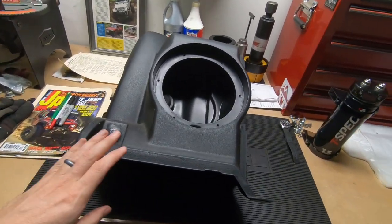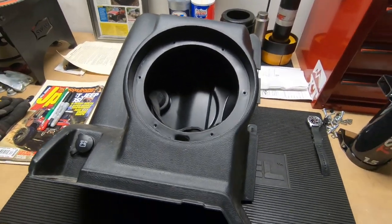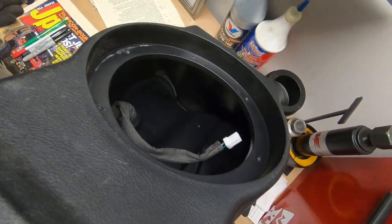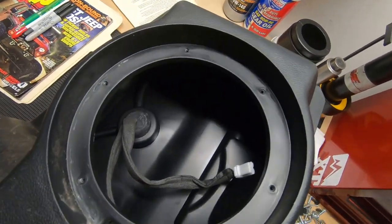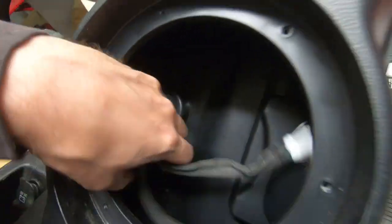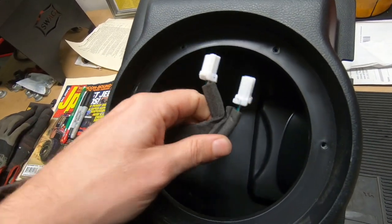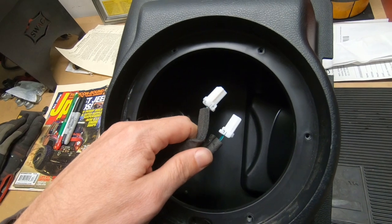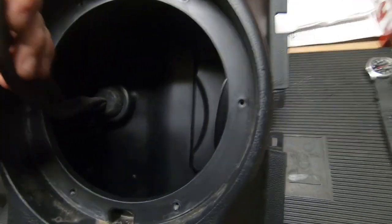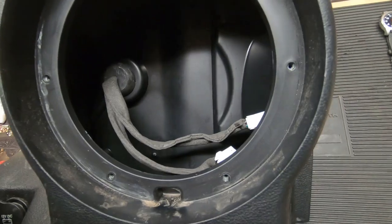Here I have my factory subwoofer box removed. I just had an 8-inch Alpine sub in it. It's a completely sealed enclosure — there are no ports. We've got a grommet to work with and four wires, two connectors that hook directly to the sub. These should be high level speaker inputs — they have 6.4 volts DC on all four pins when shot to ground. So we'll use that to turn on our amplifier.